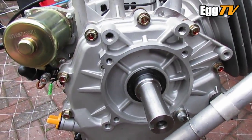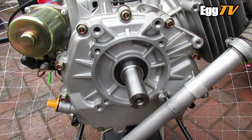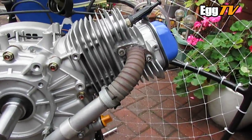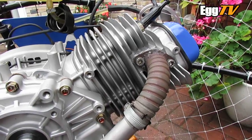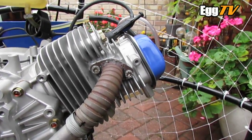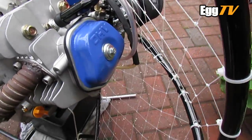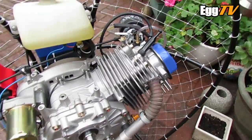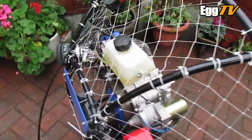So the mods: governor removed — Jocko had already done that anyway — 8 degree advance timing key, milled the head a little bit and ported it, taken the rough edges off the short sides. It's got the 1.3 to 1 ratio valve rockers and the 35 pound springs, along with a slightly thin head gasket from Vegas Carts in Las Vegas.